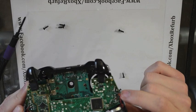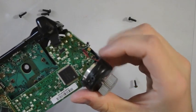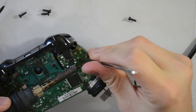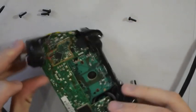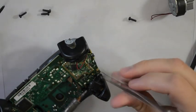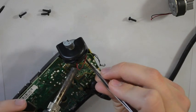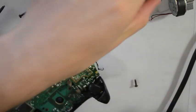First we're going to unsolder the rumble motors. Zoom in — there are four wires here for the rumble motors; we're going to take those off on each side. Just grab a soldering iron and go in and pop these off. That's one side; get the other side where you can see it — that drops the rumble motor. The top wires are for your trigger rumbles, the bottom will be for your standard rumbles. Microsoft talked about there being six rumbles in here, but so far I've only counted four.